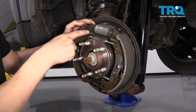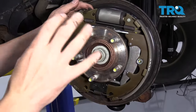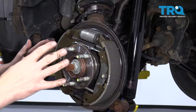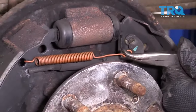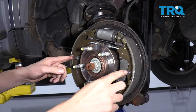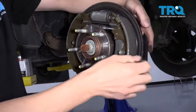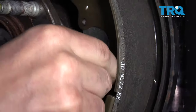To get the shoes off you'll need to remove some of the springs. It's a good idea to take a picture before you start because you can always reference it if you forget how it goes back together. The other pro tip is to do one side at a time — don't take it all apart and then try to put it back together, because it's easy to forget where things go. Use needle nose pliers to pop the spring off both sides. At that point the shoes become loose at the top, then you remove the two hold-down springs — there's a spring on each shoe. Hold something on the back because there's a pin that goes through the backing plate and through the spring; you turn the washer about 90 degrees and it releases so you can pull the spring off.